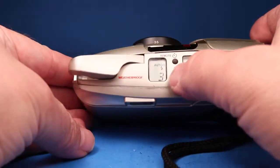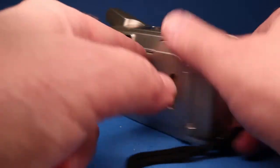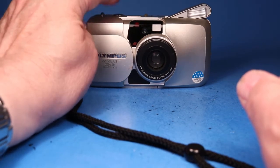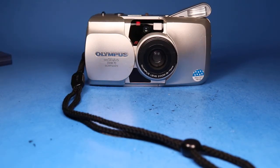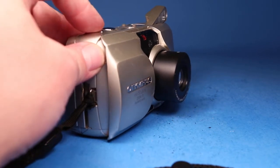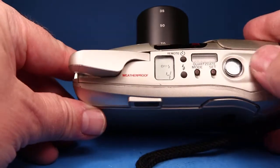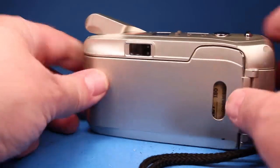Now I'm going to shut the flash off and set it for self-timer mode. We see the little timer indicator came on right there. I'll set the camera here pointed at us, press the shutter, and now there's the little red light — we can watch it complete the cycle. Then we should check that the zoom is working properly. You can see the power zoom runs the lens out from 35mm to 70mm and back, and I verified that the optical viewfinder zooms with the lens just fine.